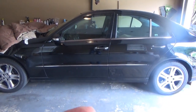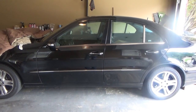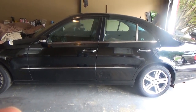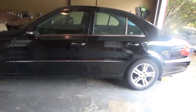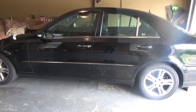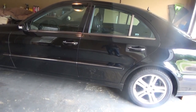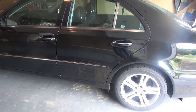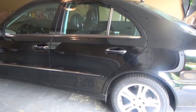This video is about a new multimeter and a dead Mercedes E500. I went to start this 2005 E500 and it was stone cold dead - most sincerely dead. I measured the battery in the trunk and it read 4.5 volts. A couple days later I found out my meter was wrong - at 12 volts it was reading 15 volts.